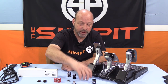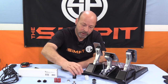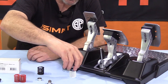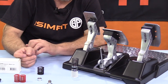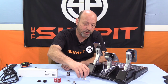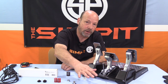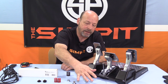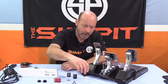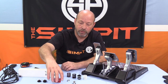I could just replace the white for one of these if I wanted softer. If I wanted the softest, it looks like I would go to this combination right here — white and silver. If I wanted it just a little bit stiffer than that, the other thing to remember about springs is they always work on the lowest resistance. You'll notice the first spring is always the softest to start compressing, and it's not until that one has enough pressure to overcome the tighter springs that they start to compress.